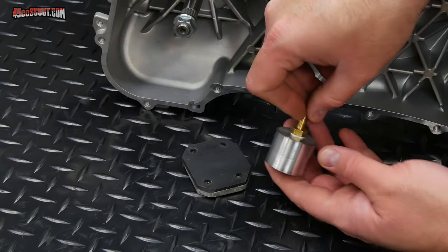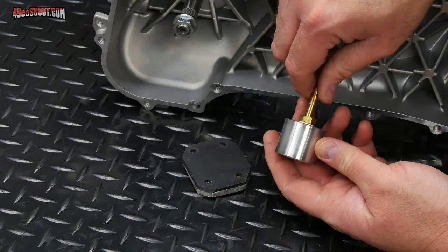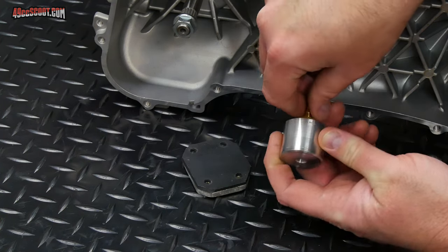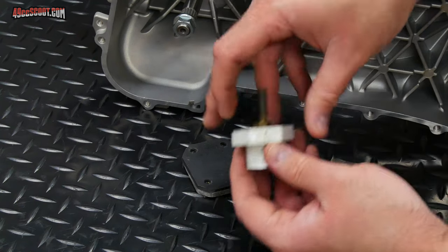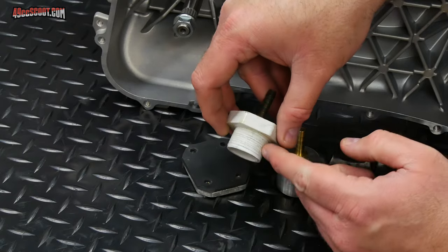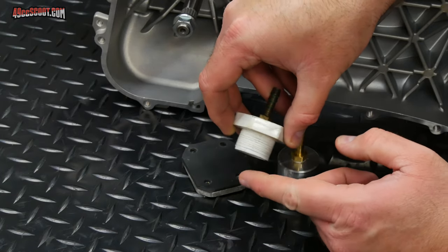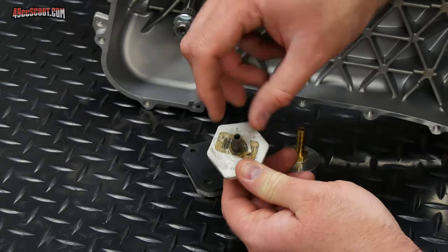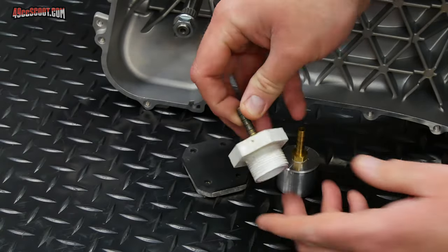These are finished up, but I got a couple of notes on these. If you need an adapter for whatever pressure test rig you have, you don't have to have a lathe like that. You can do it really simple. This was a piece of PVC that I used for another adapter. It would be better if they are not threaded, but this was all I could come up with at a hardware store, I think, the day that I needed this. And you can just drill the end and tap that, put a barb in there.